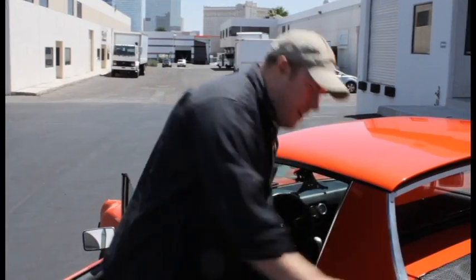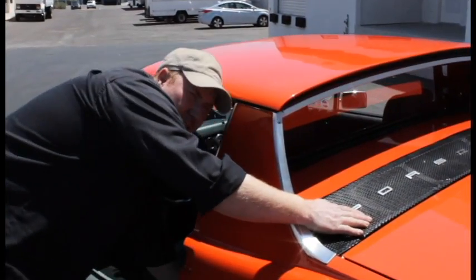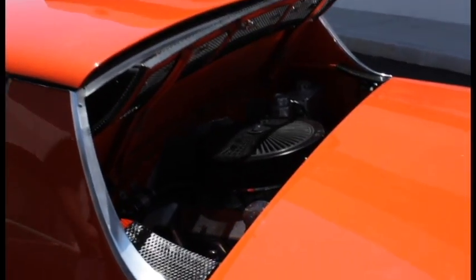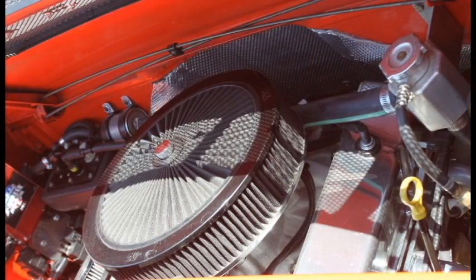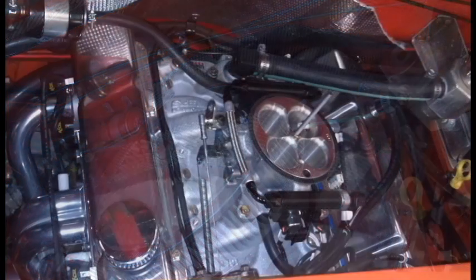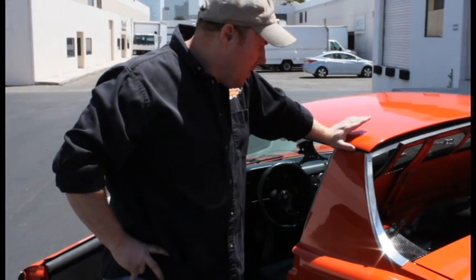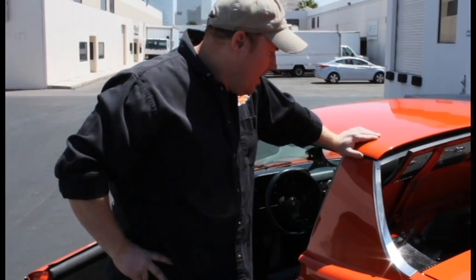Sure. All right, so look at the engine. This is a warmed up small block Chevy, probably 420 horsepower or so. It's recently had an Edelbrock fuel injection system fitted as well. It's the new Edelbrock system that uses a handheld tablet for tuning, which is pretty neat. It's got an auto-tune feature, relatively straightforward to set up. And it gives you fuel injection quality without the carburetor, obviously.